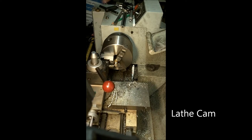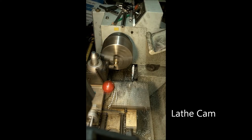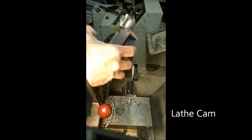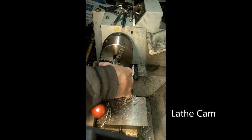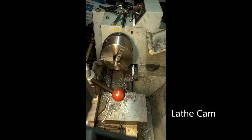Now when I get to 3 thousandths, I'm going to start putting the cylinder up and go match to match. Remember, we're going to put some rings on here, so that'll take up any slight slack. You want this to be a little bit smaller than your cylinder so that the rings will have room to expand. Okay, put the engine up to it — perfect. Absolutely perfect fit. Slides in there just right. Now we're going to put some rings in it.